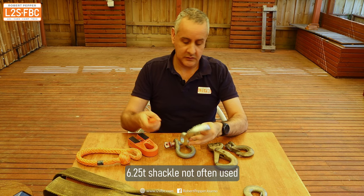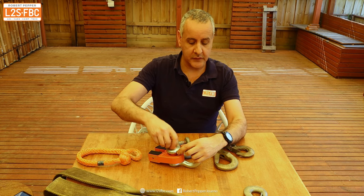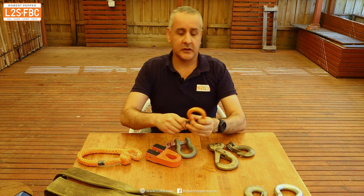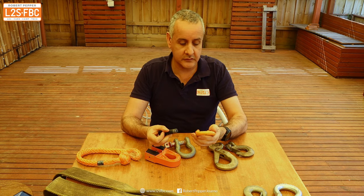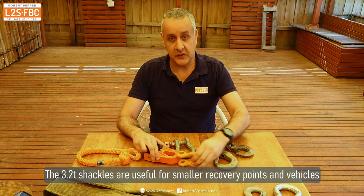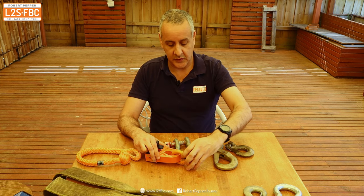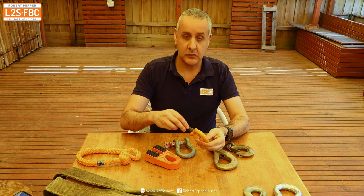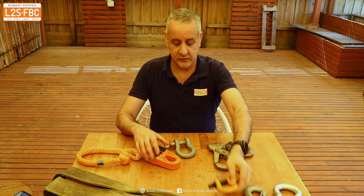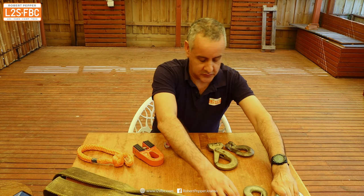A six and a quarter tonne shackle also fits without any problem. Going a bit smaller, a 3.2 tonne shackle - which is still fine for recovery because of that six times load limit - doesn't actually fit facing the right way, but you can put it around the other way and it will fit, though that's not ideal. So the flat link is fairly versatile - it will take a variety of shackle sizes, which is good, but probably not the smaller ones. With these three sizes you're pretty much covered shackle-wise.